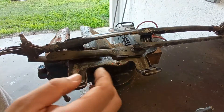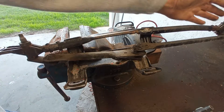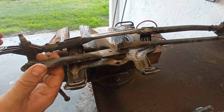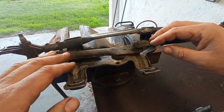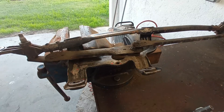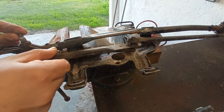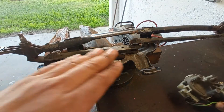Now you want to find out how this works manually. You have your wipers and wiper arms connected to these two arms over here, and if they are connected, as soon as you move them the wipers go like this. For left-hand drive cars, you have to have these bars pointing to the opposite direction of the blades - the blades go like this, and you have this mechanism to the other side. So as soon as the motor turns this part over here, it will create this movement. The crucial part is the assembly of the motor to this assembly.